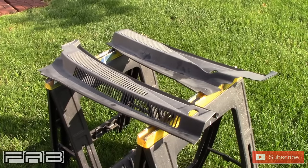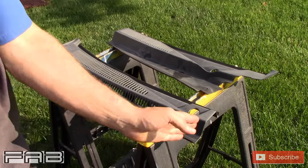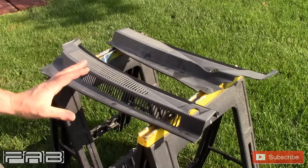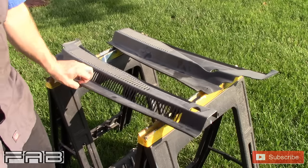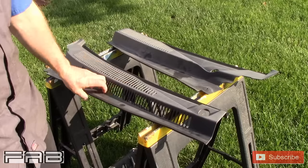The cowling is off. This piece is louvered so I've got to make sure that I spray paint going this way, and spray paint going this way, and then straight. I'll probably flip it upside down and paint along here too, because if I miss just one of these louvers it's going to stand out like a sore thumb.